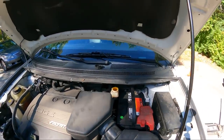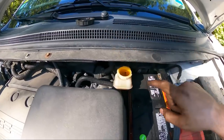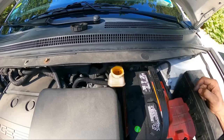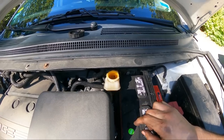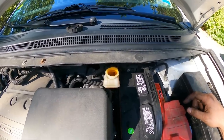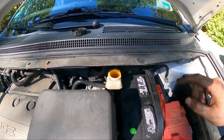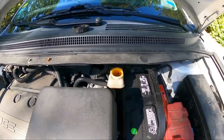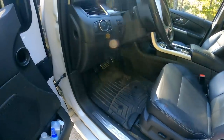Something we noticed — and kind of expected — our brake master cylinder was overflowing. We did take the cap off knowing that the brake fluid was going to overflow, and we have something under the vehicle to catch any excess fluid. Be aware that depending on your brake fluid level when you started the job, it might just overflow. The fluid will go back down once we pump up the brakes and it takes up space in each caliper. Always make sure your brake fluid level is at proper level when the job is complete.